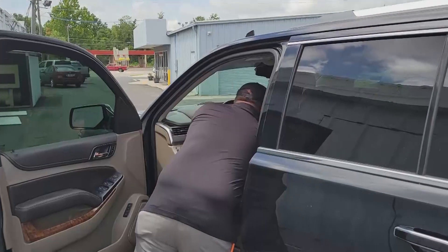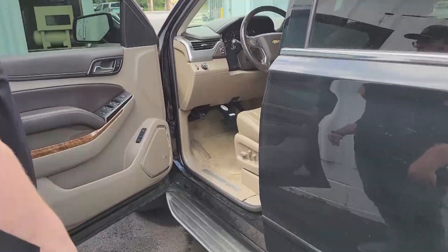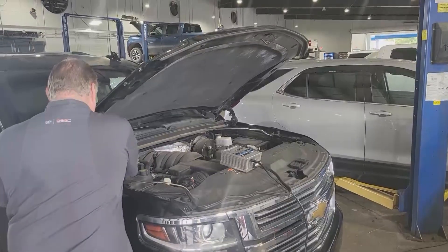The appointment was there, and it was really cool - the tech kind of walked out to the car. Visual inspection - that's exactly what he was doing. He inspected the vehicle, went round and round to check for dents and scratches. He took a scan tool and looked to see if there were any codes being thrown by the vehicle - and guess what? Your vehicle had a code. It was a C0273, a chassis code - a brake fluid level sensor problem. We'll address that after the commercial.